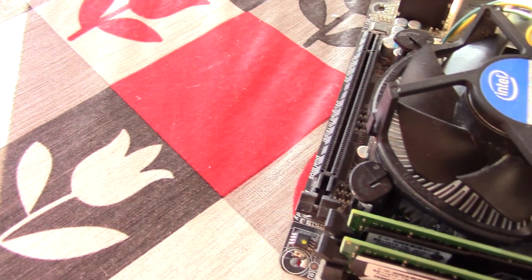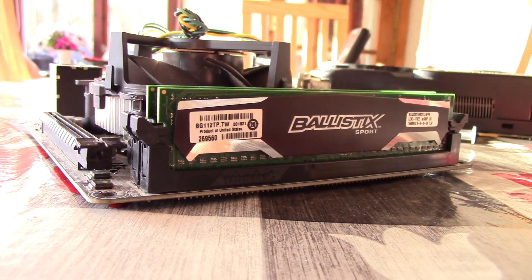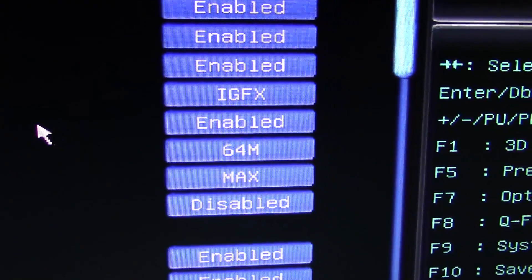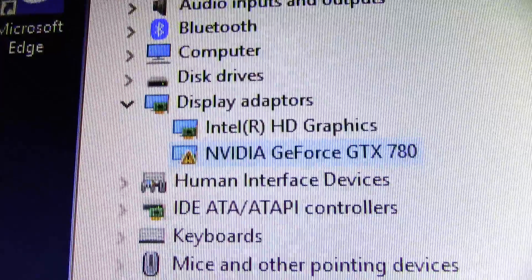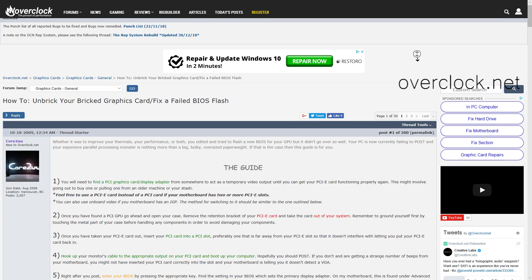Enter this — a mini-ITX motherboard combo I picked up on eBay, which features an i5-3450 with Intel HD graphics built in. This meant I could connect my monitor using the Intel onboard graphics while still having the 780 in the PCIe slot, ready to be flashed. I went into the motherboard BIOS, changed the primary display to the onboard graphics, and got back into Windows. By some miracle, device manager detected the card this time round — the download bar finished and the 780 was installed.